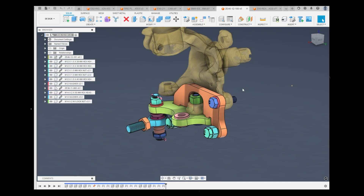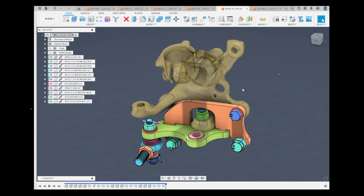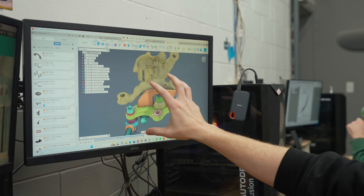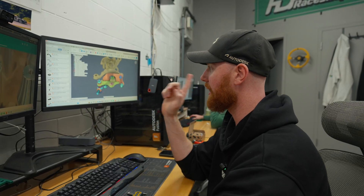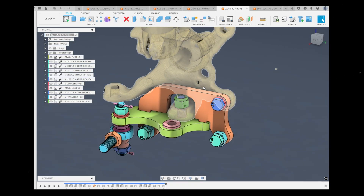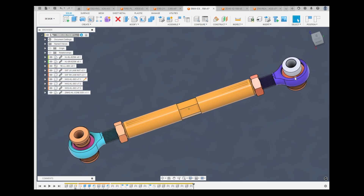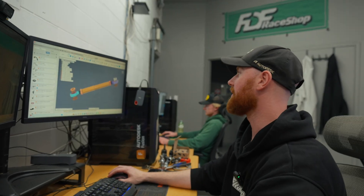The next thing I was working on is a mini kit for an E46 — much different than anything else that's been created. We are using the brake caliper mounting position and then the OEM ball joint position. The reason I wanted to do that is because a lot of people have already modified their tie rod location, and I wanted them to still be able to get a mini kit onto their knuckle. This kit is actually still capable of achieving the full amount of angle as nearly a mega kit if you extend your control arm. You can connect this directly to an OEM control arm, run around 52 degrees of angle, it's really strong, bolts on, and you don't need to change anything else. So that's what makes this a really good kit and different than anything else available.